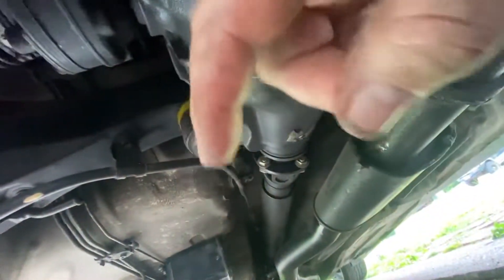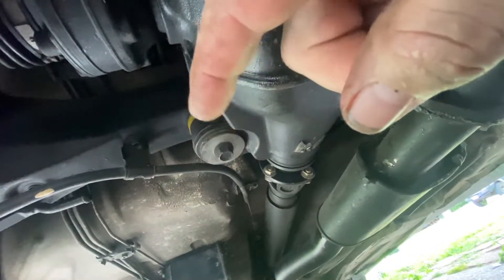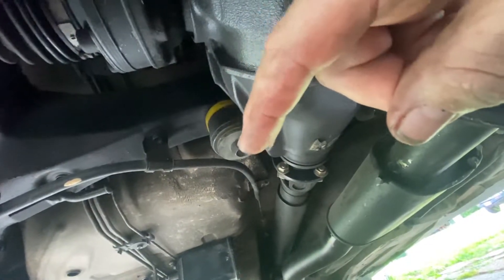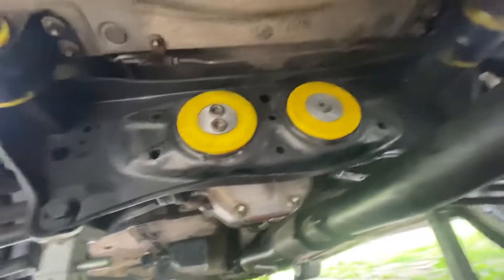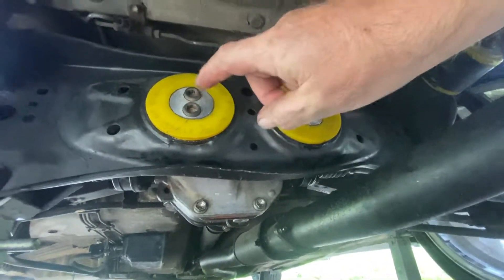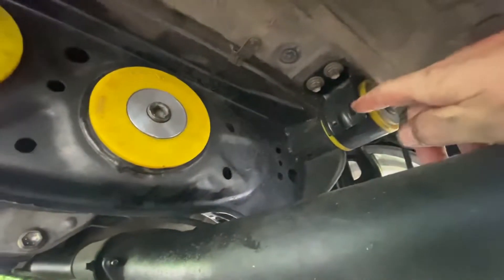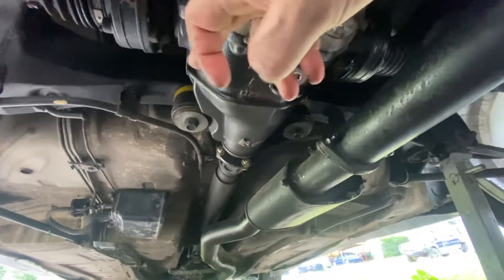In order to fit the GT86 diff, a lot of people use the GT86 bolts. But what I did was I changed the front bushings for JZX bushings and used my existing JZX front bolts. You'll see these yellow diff bushes - this brand is called Strongflex, they're from Poland. I did all four corners of the cradle, the rear diff bushes, and the front diff bushes.